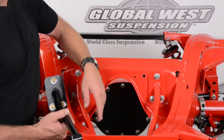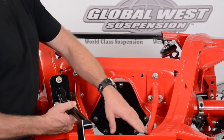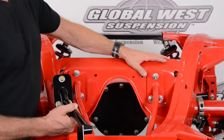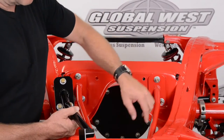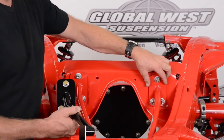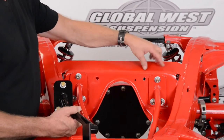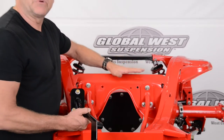You can go ahead and weld all of this. On this side over here, same principle — this is for that extra arm that you can put on these particular vehicles, and we actually make a kit for that. Same premise: welds onto the frame, ties up here where the upper control arm mount is, so it sandwiches the frame. When you put these on, this is going to protect the frame from pulling back, which is one of the big problems on 59 through 64 Impalas.